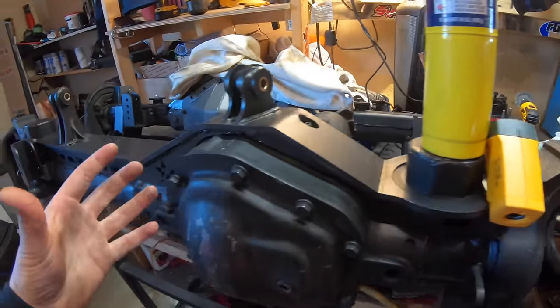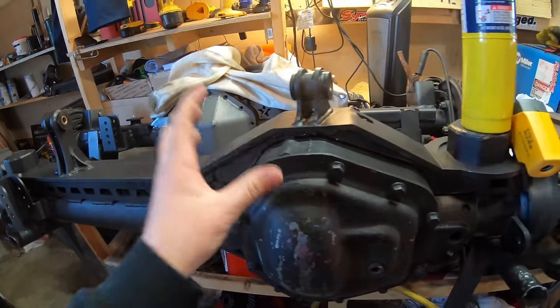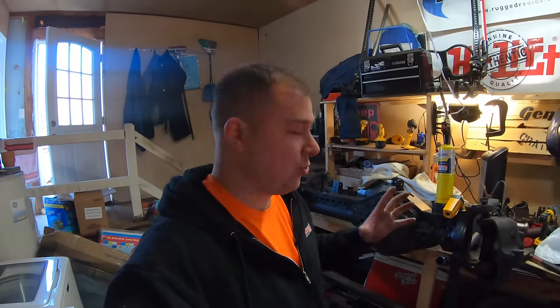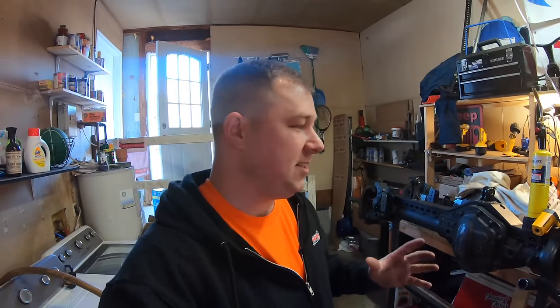Normal trusses are made out of mild steel, and most modern differentials are made of cast steel. It's very important to weld the truss at least in a few places to the actual cast steel, opposed to just making the welds on the axle tubes — it's going to help strengthen up our truss. You'll also find cast steel on your outer C's and knuckles, so whether it's C-gussets on a Dana 44 or welding a truss onto your Dana 30, lots of places have cast steel. It is different than cast iron, which is a completely different topic and a lot harder to weld to. Cast steel is pretty easy to weld to with a few steps, so let's go ahead and dive right in.